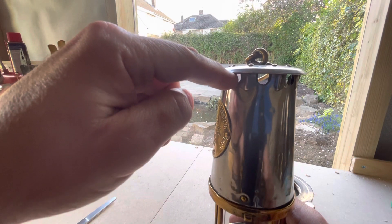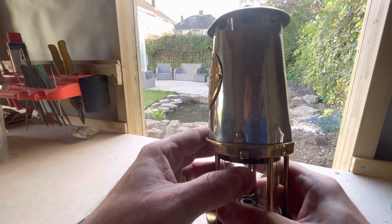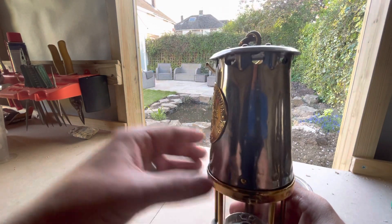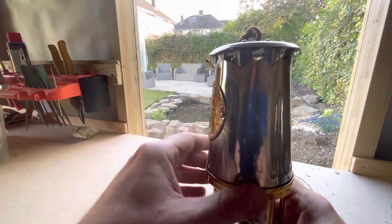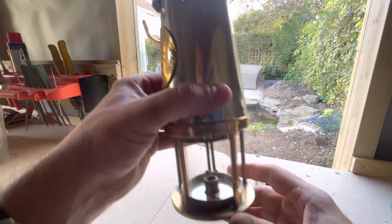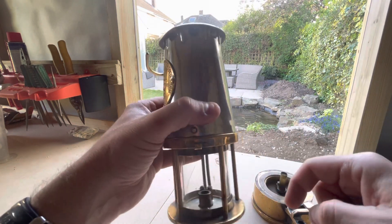When testing for gas at roof level, you want the air samples to be drawn in at the top and into the flame. The miner would close the shut-off ring to the shut position, then read the gas cap. When finished reading the gas cap, they'd open the ring up again and the air would flow in normally under there and around the glass down to the flame.